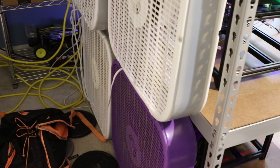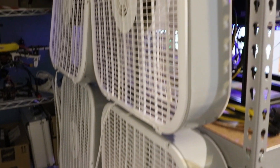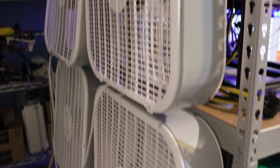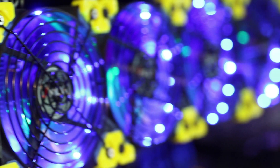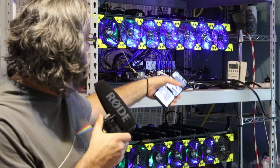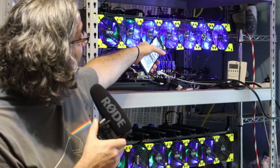I'm going to take you for a little tour and show you what I've got going on. Back here I've got real cheap box fans — I've tried tons of different kinds of fans and these things are just fantastic. I'm up to probably six of them now, and I'm blowing air across the GPUs. These fans right here used to be on the other side of the GPUs as pushers, but because I'm using the box fans, I've brought these around to the front. So I'm using the big fans as pushers and the small fans as pullers.